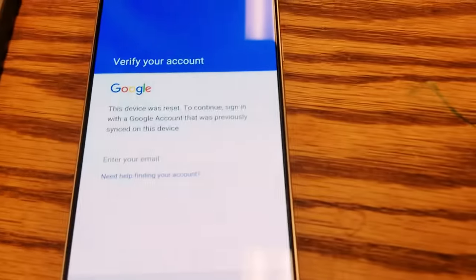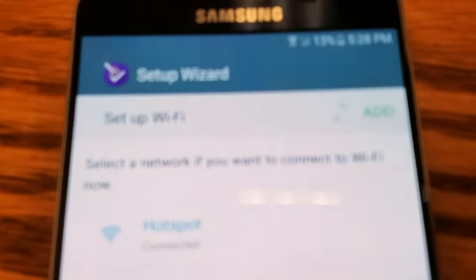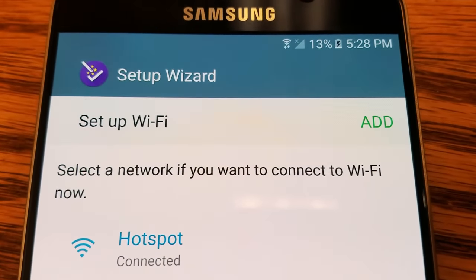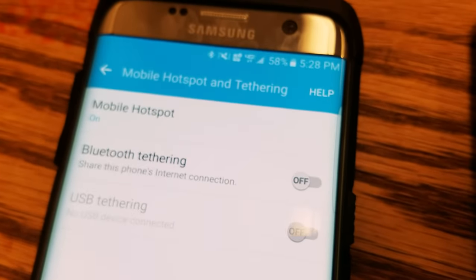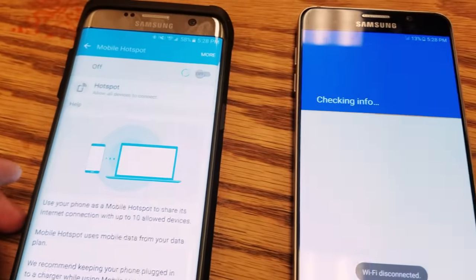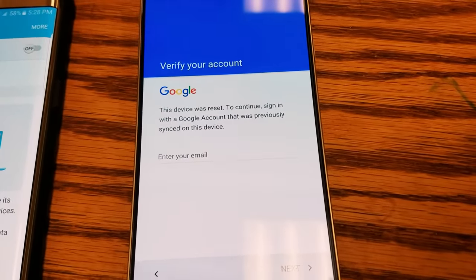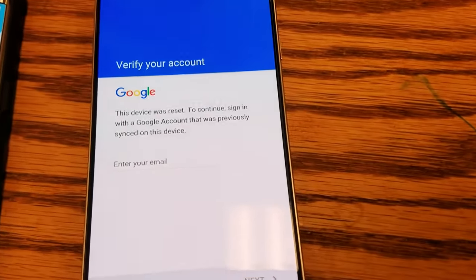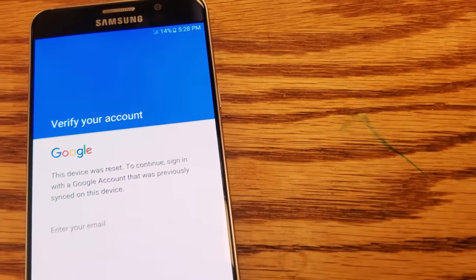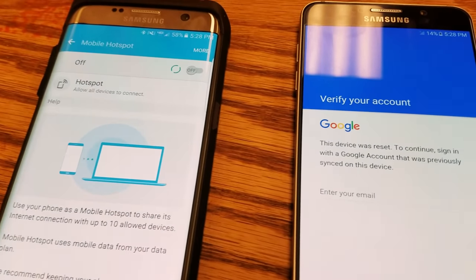All you have to do is go back to the WiFi settings. We're connected to my hotspot right now. Click next, and when it says 'check in connection,' you want to turn off the WiFi. You have to be quick about it though. Sometimes it will take you straight through — we're going to be a little faster next time. It can take two to three attempts to get the timing just right.